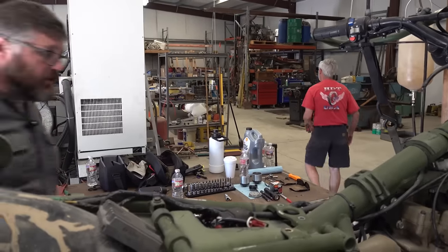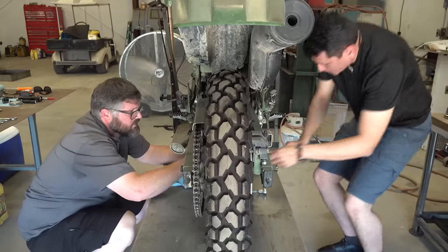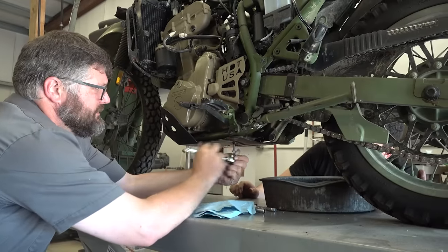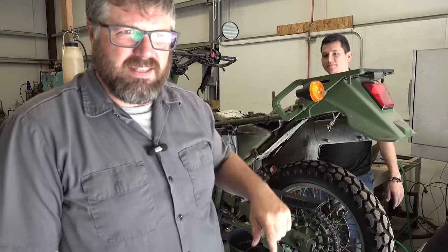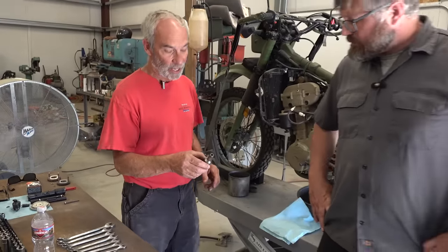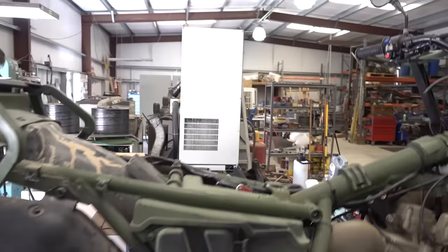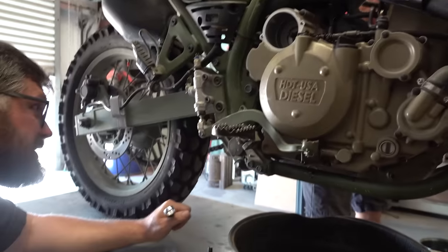After pulling off the exhaust, stator cover, and skid plate to get better access to the bike, Rick finds left and right hand threads on the crankshaft — almost like a turnbuckle — so as you tighten the collar it cinches everything down on itself. Then removing the primary cover reveals someone has been in here before. There's wear visible, a missing washer, and a double gasket — never double gasket, as your chances of an oil leak increase by 50 percent. The crankshaft bolt is loose and the Woodruff key is missing.